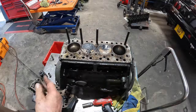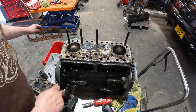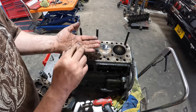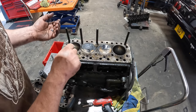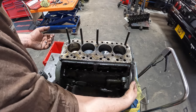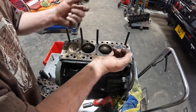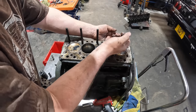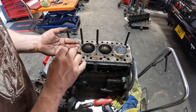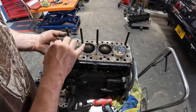There's no real trace of the head gasket blowing, but it didn't come in for that - it was oil consumption. On top of the piston there are real big flakes of carbon. Luckily the acid will take care of all this - it will just eat all this carbon and paint off it when we come to it.